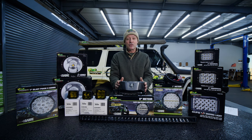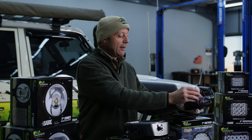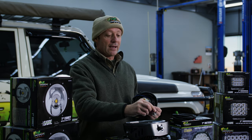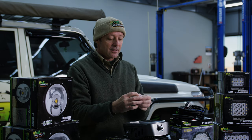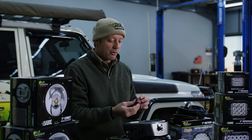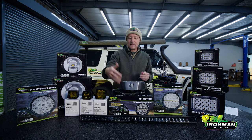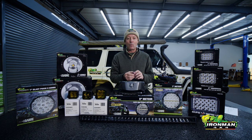To switch the lights on and off we use a heavy duty switch called a relay. This relay can handle 40 amps of power, which is more than enough for this bar light or two of these spotlights. It will switch on and off that 16 or 25 amps of power running through your thick wire.